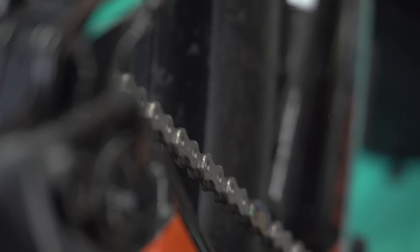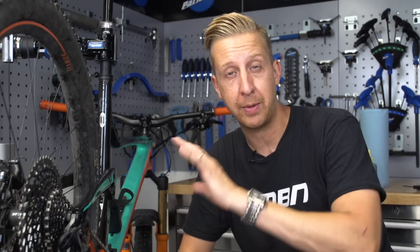What you don't want to do is just keep putting more lube on top of more lube, because the bad thing about that is you get this big gunky drivetrain — you're going to start getting miss shifts and it's going to attract loads of additional mud. It's basically up to you to monitor it depending on how often you ride. This sort of thing is really a post-ride task — you don't want to be doing it pre-ride. The idea is you come home from your ride, clean your bike, give it a bit of TLC, lube it, and it's ready to go next time. Don't be one of those guys where everyone's waiting for you at the start of the ride while you lube your chain and pump up your tires — do it after the ride.